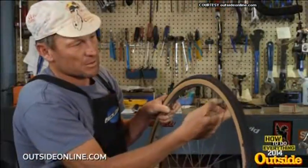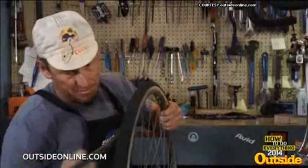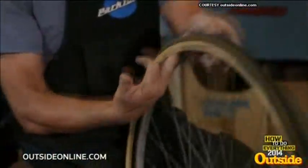I'm doing pretty good for a guy that just learned how to do this. Take out the punctured tube. What people sometimes forget to do is to check the tire, because obviously you got a flat tire for some reason — unless you had some sort of a pinch — but a lot of times you'll have a piece of glass or a thorn in there, so you just run your hand through here and hope that the piece of glass or thorn doesn't cut you.